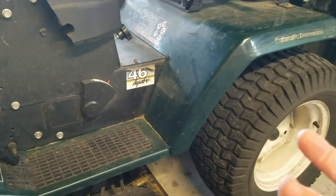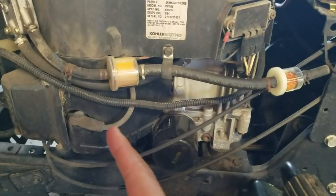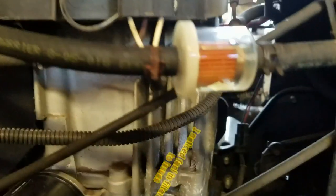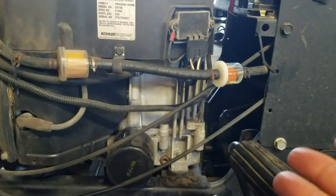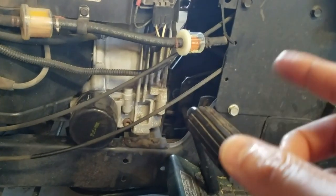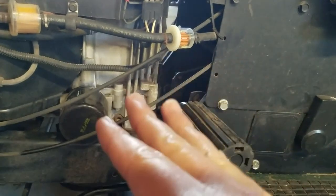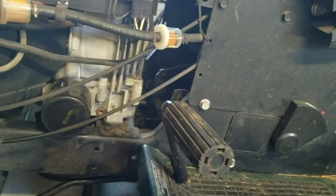I just wanted to put on YouTube exactly what I did to fix it, and so far it's been running great. There are two filters on here, and I noticed the filters were dry. You can see now there's a little bit of fuel in here — I've done the repair. Once you notice that it's dry and there's fuel in the tank, that means there's not fuel getting to the engine. I thought I would replace the fuel filter anyway, and there was basically no gas whatsoever getting through the line. My guess is these lines probably need to be all replaced — maybe the ethanol is eating them, and there's probably garbage in the tank.